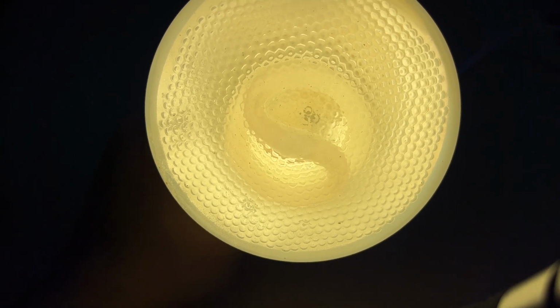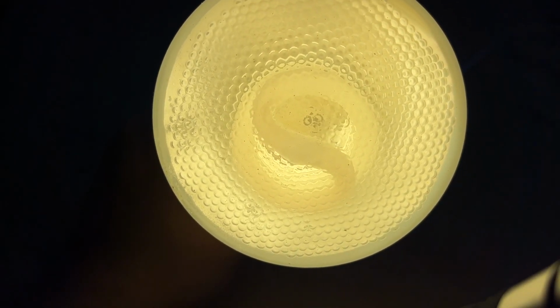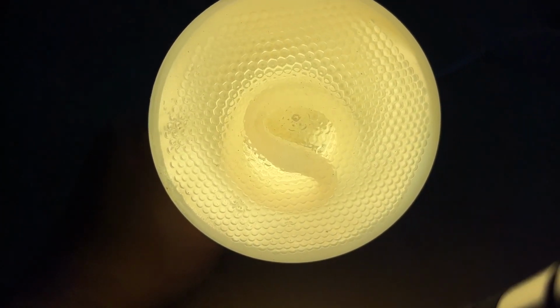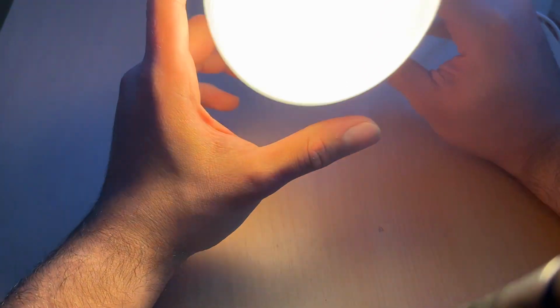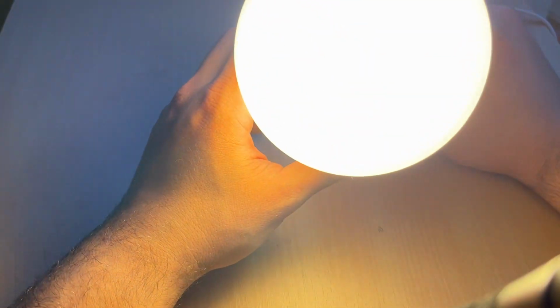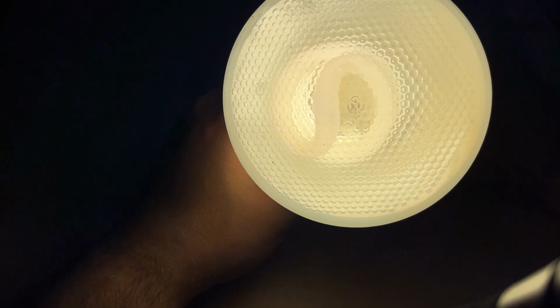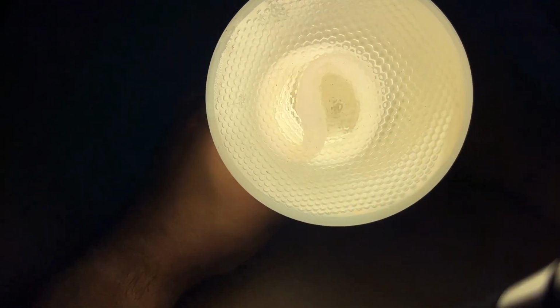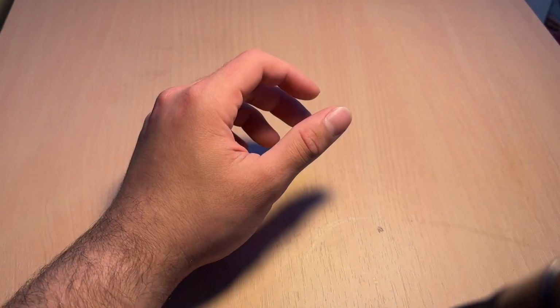And I think it's lighting from what's now the right side to the left, because it looks like the left side is still pretty dim. And the right of the CFL is warming up more quickly. Now I'd say we're at maybe a 40 watt, 45 watt brightness. Let it light up the area. It does produce a good flood, I'll give it that. The color temperature is not a warm white or a soft white, but it's not daylight. I'd say it's probably a cool white. Maybe 4000K or so. Oh, maybe 3500, hard to say. We're nearing full brightness. It's decently bright now. Again, I don't think 75 watts of brightness, but we'll keep it going.